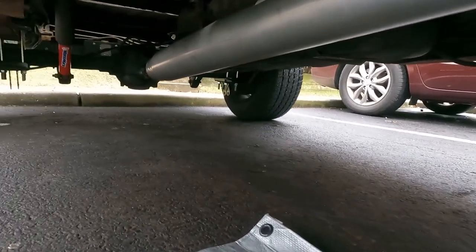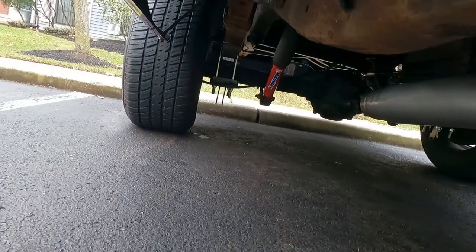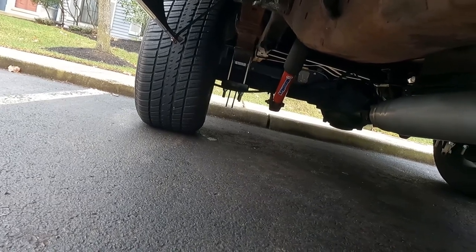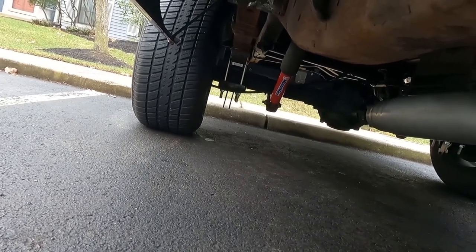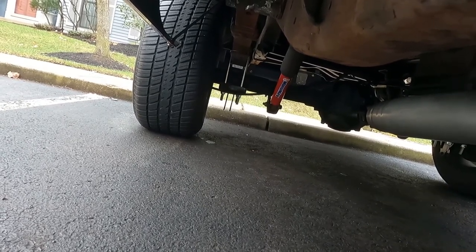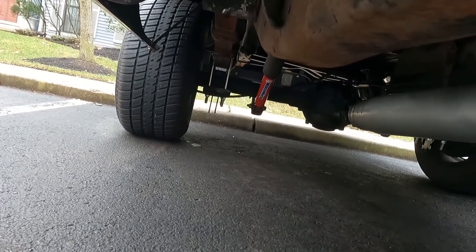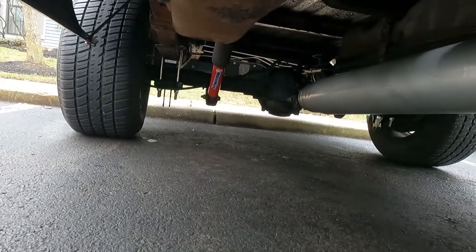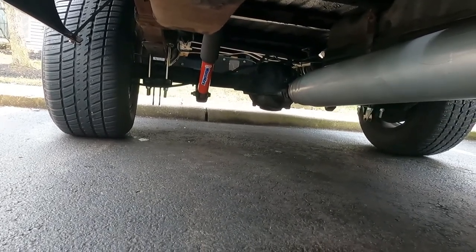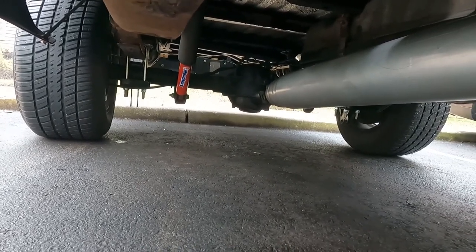Okay, so now that I have my rear shims in place, pinion angle's been corrected to definitely closer to where it needs to be. Even though it's a 6 degree shim, they actually gave me about, I went from 8.9 to about 2.3. So they're not perfect, they're not going to give you exact, dead on, because that's almost impossible to manufacture. I mean, maybe it is, who knows. By the way, that works out great for me. That's even better, because they didn't have a 7 degree, which is what I would have gotten.